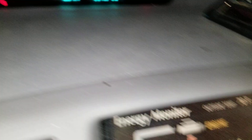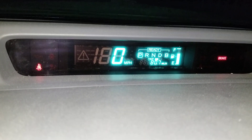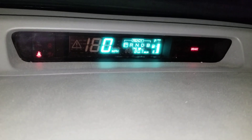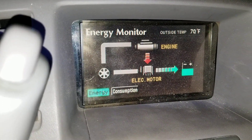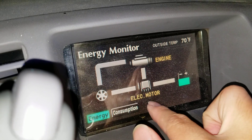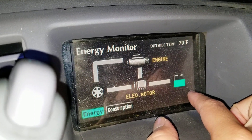If you're stuck in red triangle mode and it won't show the energy screen, and you have tools, shut off the car and disconnect the negative battery cable. Wait about five minutes, reconnect it, and it should reset so the triangle no longer shows. Then do this charging trick and let it run. Once charged, if you need to drive, accelerate a little harder than usual — if you accelerate slowly it'll try to pull power from the hybrid battery, and you don't want that when it's low.